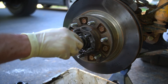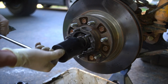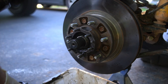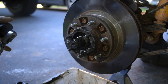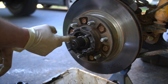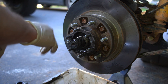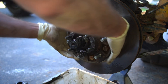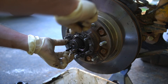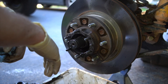Now you can take a pick tool and retrieve your star lock washer. Below that there's another nut using the same socket. Go ahead and set those off to the side in a safe place. Now we can actually remove the hub and rotor as an assembly. As you go to pull this, your front wheel bearing is going to start to pop out — just make sure it doesn't fall in the dirt. Pull it out, and then we got a spacer and our outer wheel bearing. Now this whole hub assembly and rotor should just come right out.